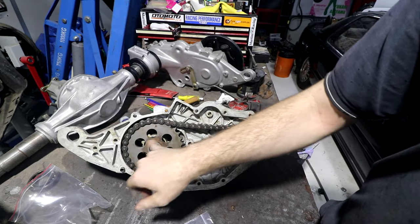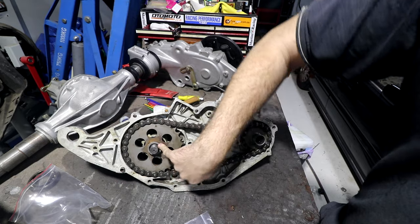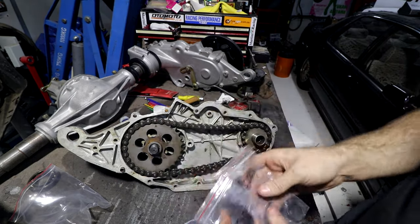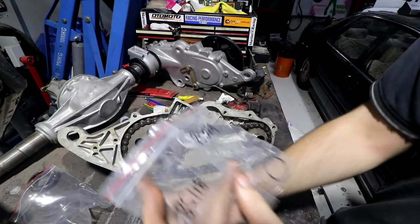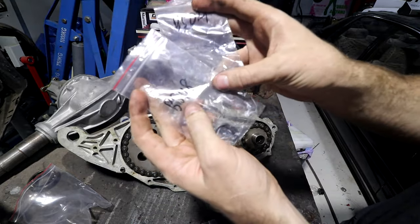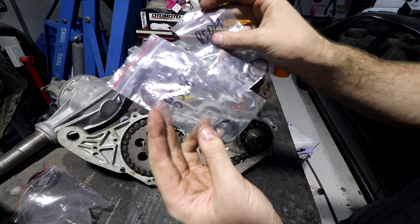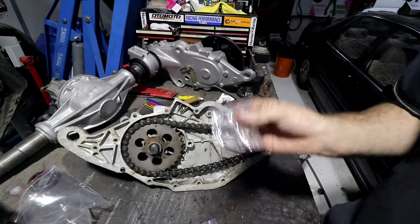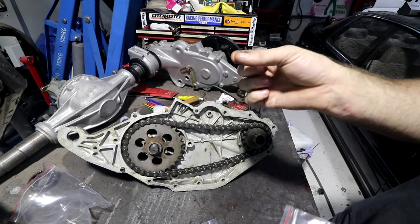So there's obviously a seal that goes here, and what goes there is an O-ring. These are the only two I have left in my bag when I ordered them. Unfortunately, O-rings aren't as nice as seals where they say the size, they just have random numbers. This is a BS118, this is a BS021. I'm pretty sure that does decode into the size, I don't know what it is. Once again, you just go to the bearing shop and say, hey, I have this, can you give me another one please?